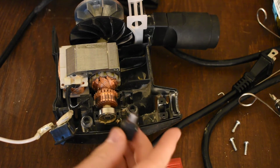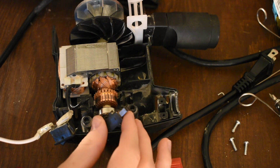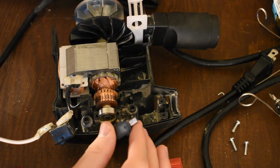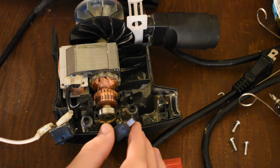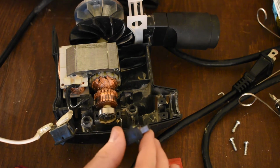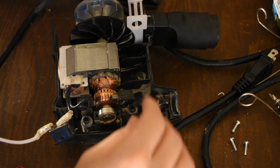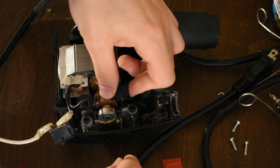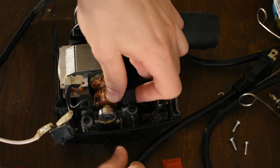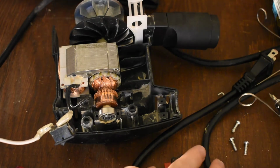So these have to be glass fiber reinforced. Glass fiber reinforcement is very good for the thermal characteristics. I mean, it's still a piece of plastic. It gets too hot, it's still going to turn to soup. But it is going to get hot, and this will turn to soup slower. And that also tells us why the housings are these drop-in things. How they drop into the clamshell is because they're different materials, so they had to come from different molding processes.